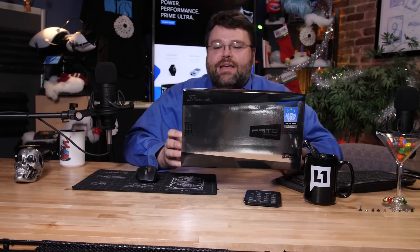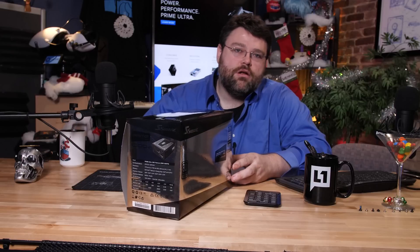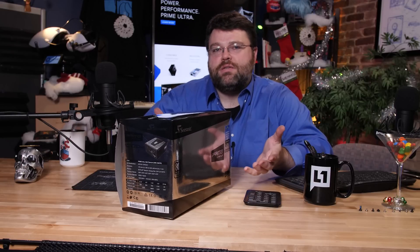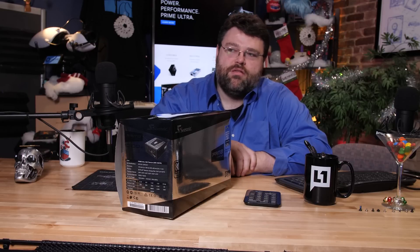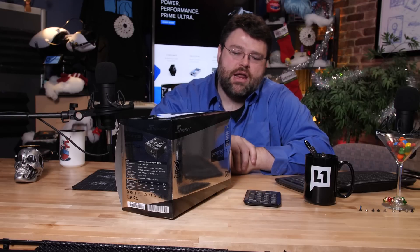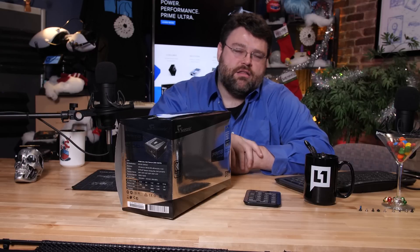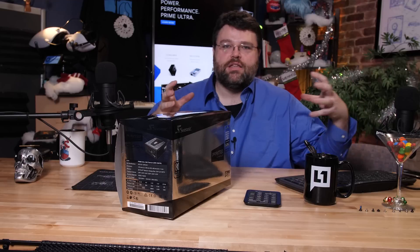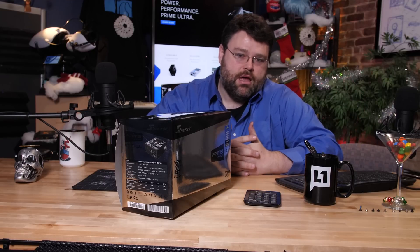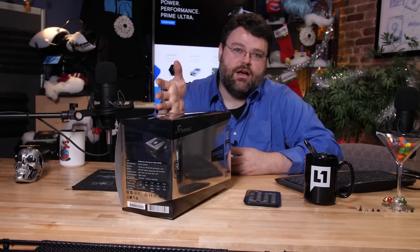It's really talking about waste heat. Now this is a thousand watt power supply. I think it's going to be appropriate for up to three graphics cards or up to three really power hungry devices. Maybe you're getting into machine learning or something like that. You could do cryptocurrency with this power supply, but cryptocurrency miners are more concerned with the cheapest power supply per watt, so physically larger non-ATX power supplies are typically what miners are going to buy. For machine learning or a corporate workstation with a lot of power hungry devices, this is more appropriate.